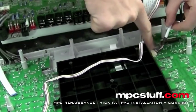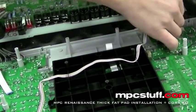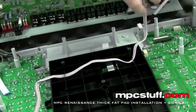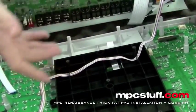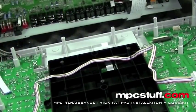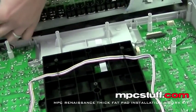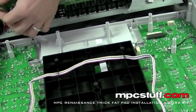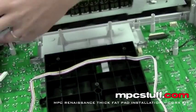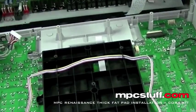Now that I have that out, I'm going to take this one off here. Remember where these all go — this gray cable goes here, that's going to pop out here. Then there's a cable right here, it goes on the bottom side, the black one — pull that out. This one is the only one that we're going to keep on the inside board, so we're going to pull this out here and leave it with the inside of the board. Now our back panel is almost loose. We have two more right here which pull out here and here. These ones will also stay on the opposite side where they stay in the board. These ones obviously have to stay in the board because the other side is on the front. So now we've got everything loose and we have our front panel separated from our back panel.